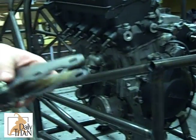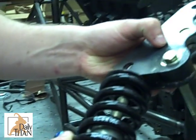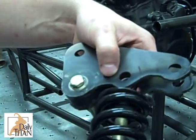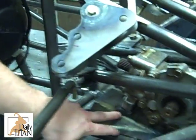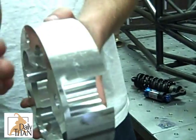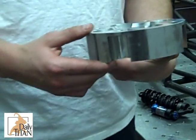What are some of the hardest parts of making this car happen? Well, for instance, these cuts are obviously super ugly, but that's because the guy who designed them didn't account for the rotation — normally they were flat like this. The holes line up but you can't rotate around them, so he had to grind them all away so we can rock on them. We also got the angle wrong on a spacer. The wheel we're working with has a ridiculous offset — the inside of the wheel is way out towards the outside, so we had to make big spacers to reach it. We couldn't afford wheels at the time, so we had to design around them.